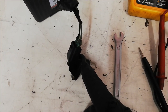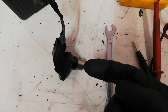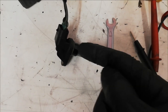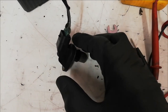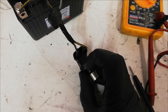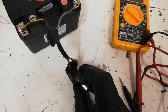This is a cam position sensor — what they call a hall sensor — and it works off magnetic current. There's a little metal probe that sticks out from the camshaft, and as it passes the front of the sensor the magnetic current basically acts like a switch, giving you 12 volts through the third pin. You have a positive and negative supply all the time, and when that third pin gets a 12-volt supply it proves the circuit is working.